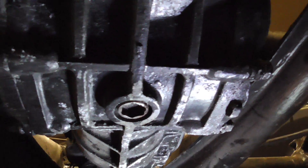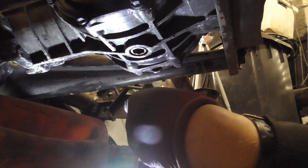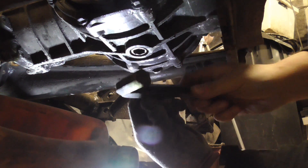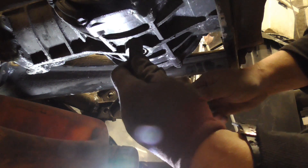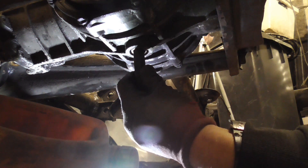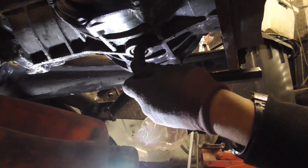I'm going to take the drain plug out. I'm going to use a 17mm hexagonal Allen key — a monster Allen key. It's a bit sloppy in there so I'm not sure if it's actually a 17 or an 18 to be honest, but it's what I've always used.